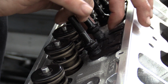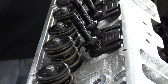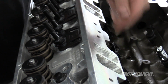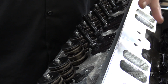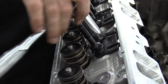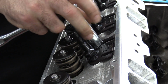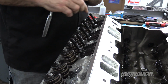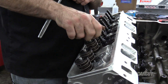Why would you prefer screw-in studs over press-in studs? Normally what they do at the factory is they'll press these studs in rather than have them threaded in like this. It's not a high horsepower application. It doesn't have as much stress being put on these components, because the push rod on a higher lift camshaft especially is pushing up really hard. The springs are also stronger and pushing back. So there's a lot of forces being exerted onto this, and if it's just pressed in, it'll come right out. So I'd say even if you're using stock heads and they don't have threaded rocker studs, get yourself some threaded rocker studs. The best setup of all, I believe, though, is a shaft rocker setup. That means most, if not all, of the rocker arms are on a shaft mounted system, and that really locks them down. It's expensive though, super expensive.